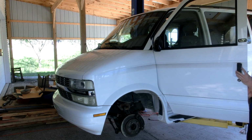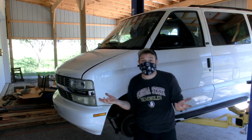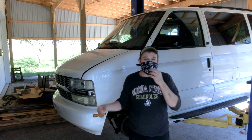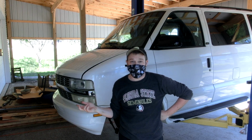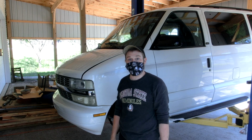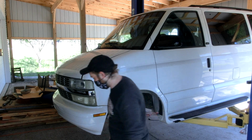I'm going to reach in and pull the hood release on the van. That's easy to do. You can find that on your car. But something not everybody knows is that there's a secondary latch on the hood. So in case you accidentally pull your hood release when you're going down the road, there's another latch to keep your hood from flying up and impeding your vision. Most cars, you have to peek underneath the hood and find that secondary latch to lift it up.